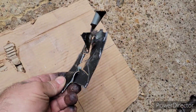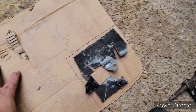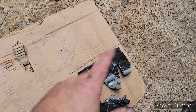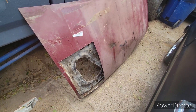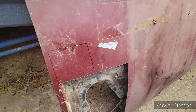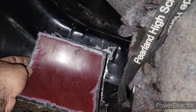So it was costing me some extra time, not really money, because I have the metal laying around anyway. I took the piece they tore up, cut out a new piece, straightened and flattened it out. I traced it on a piece of cardboard, then cut a section out — it's a little bit too big but I'll fine tune it after bending the cardboard and making sure everything lines up right. I traced the cardboard over here on the old Bronco hood, which I kept just for getting pieces of metal off of for other projects.